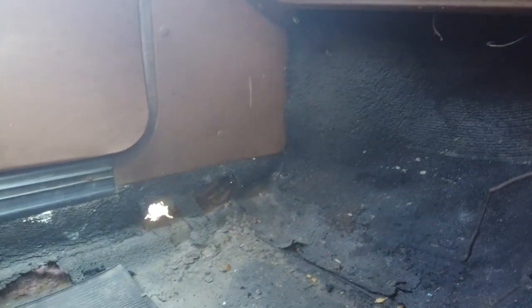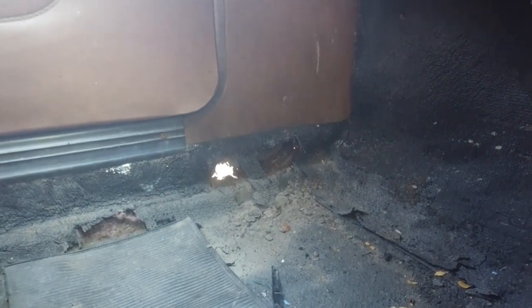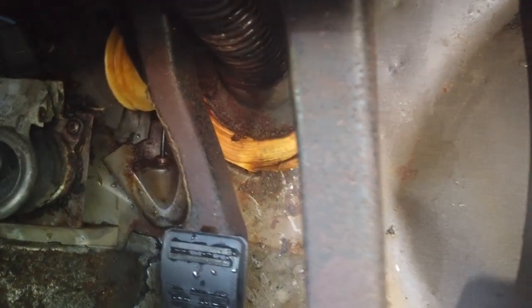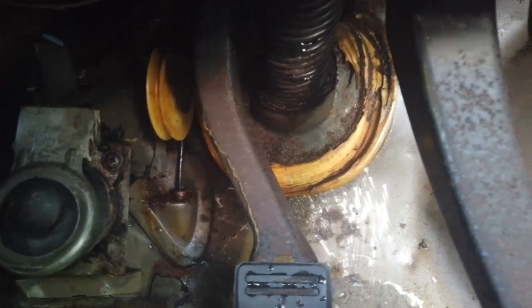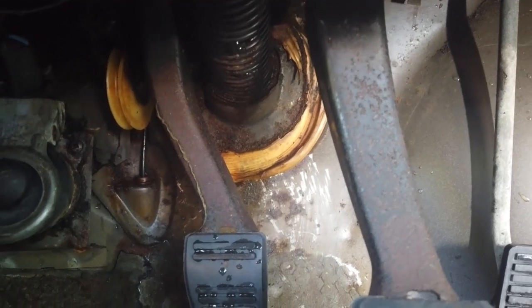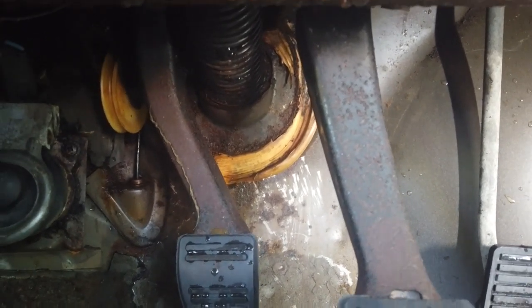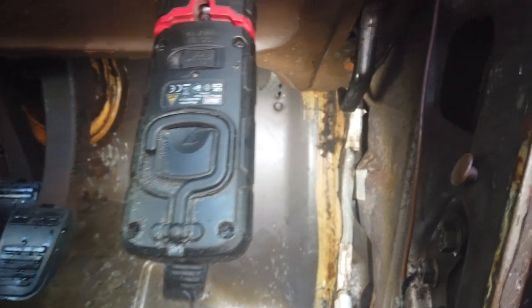Going to the other side - although I'm not going to be tackling that just yet. We see a similar story - could be worse, probably is because it's near-side up further by the pedals. We are good to go there. There's no rust, a little bit of corrosion around the steering column surround - something's leaking in there, could be a perforation in the bulkhead. It does correspond to where there's some rust in the upper part of the bulkhead. We'll investigate that. Further up the A-panel, we're good to go, no rust.